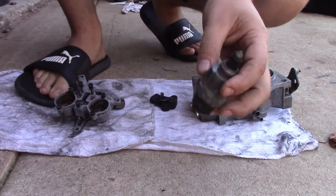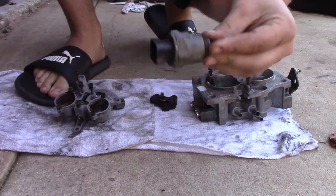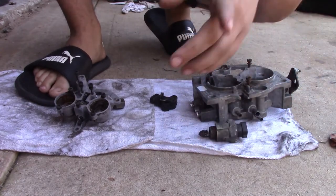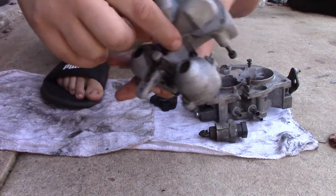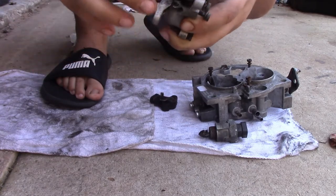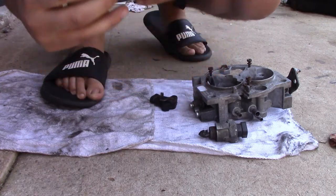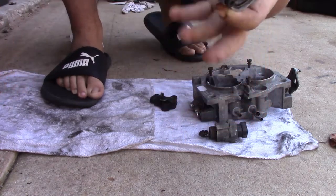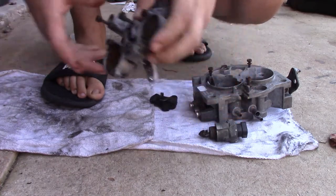This part right here is going to be your idle air control valve — pretty simple, and this one looks okay, hopefully we don't have to replace this. Make sure your gasket surfaces are very clean. This thing's been soaking in vinegar so all these gaskets should basically just fall off. I had this soaking in vinegar because of a lot of rust in it. I still didn't get it all out, but we're going to try to save this thing — I'm not sure it's savable, I may end up going with the junkyard TBI unit.